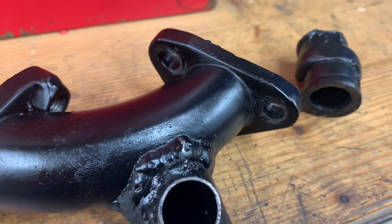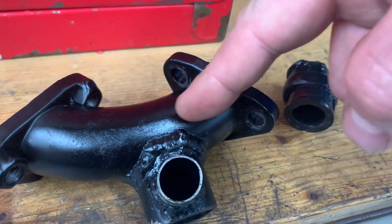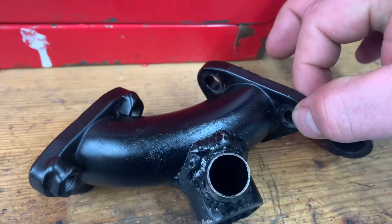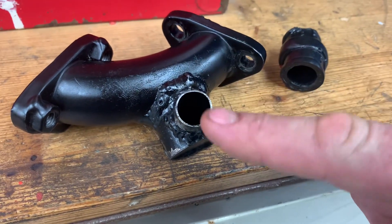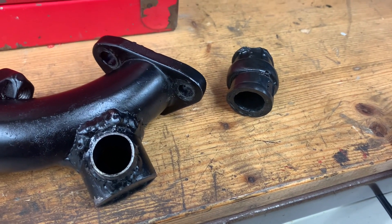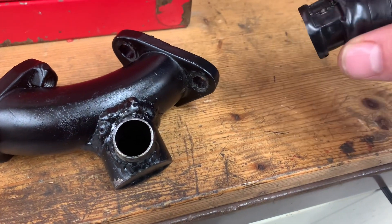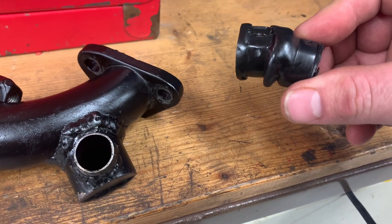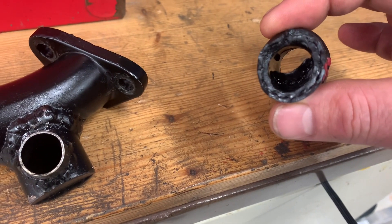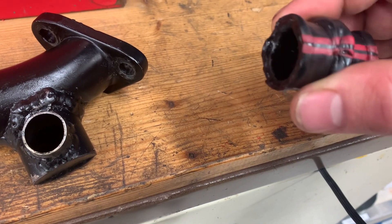So here we are with the parts I've just been showing you so you can get a better look. This original elbow was really nicely made — the flanges were all silver-soldered on, it was beautifully put together and it looked fantastic until I had to add on this mess, which is now going to be getting removed. If there was ever any evidence to prove that I was right to take the car apart, this is it. This is the pipe — it's puckered up over time, that was perfectly straight when I fitted it. If you look inside you'll see how it's closing in. It's probably only half of that pipe now flowing — the other half's restricted — and eventually that pipe would fail.